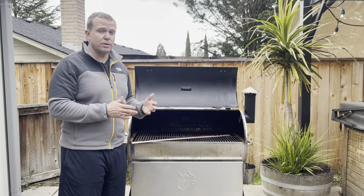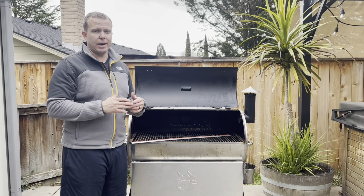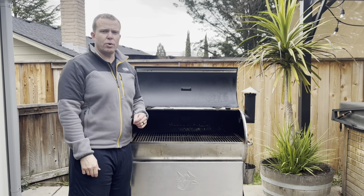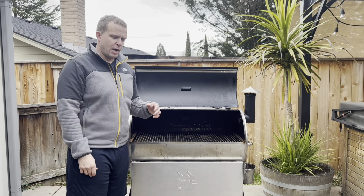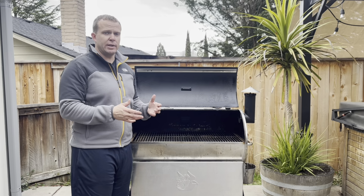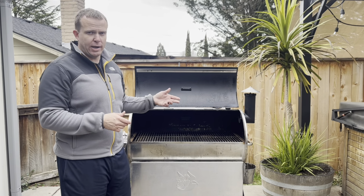So once you get this drip edge installed, you're going to want to let that RTV cure before it sees any kind of heat, moisture, anything like that. All right, everybody, so we're ready to get that drip edge installed. I know I just mentioned that it does help to have two sets of hands when you're doing this. Somebody maybe on the backside to help align those bullhorn handles for you.